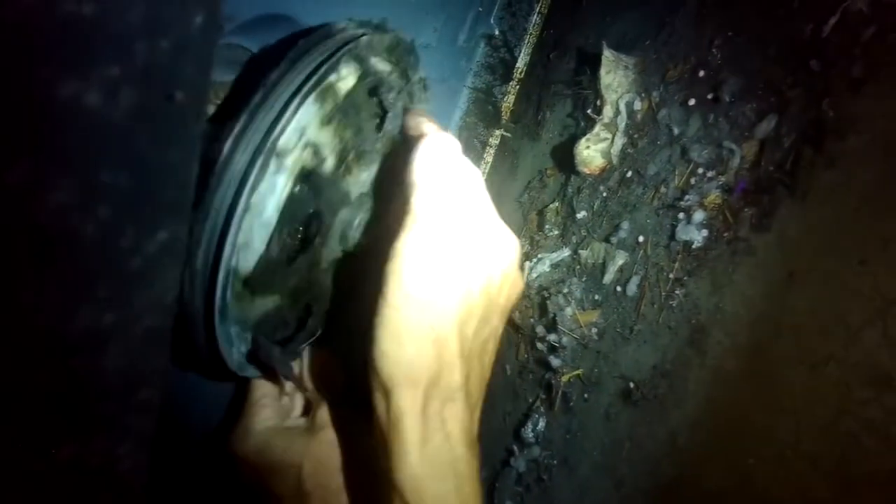In the agitate direction going left it seems fine, but going right — when it has to move the spin basket — it's really difficult. It's pretty rusty inside too, and it's an older unit. I think the bearing is so corroded it's causing a lot of friction and preventing the spin. That would be a pretty big job to change that main bearing, and because the machine is so corroded, it may be best to just get a new machine.